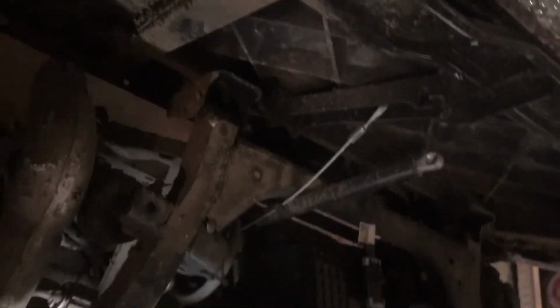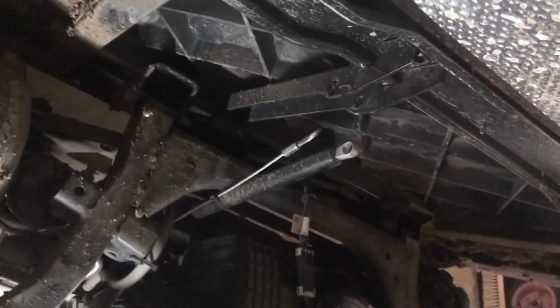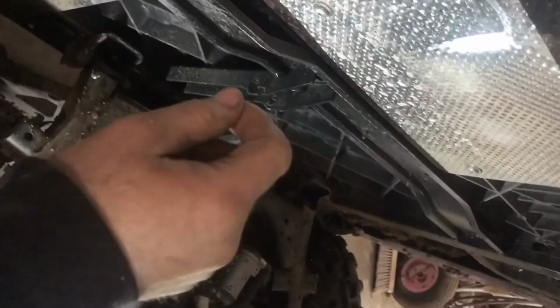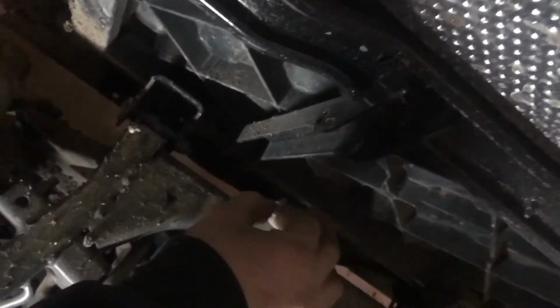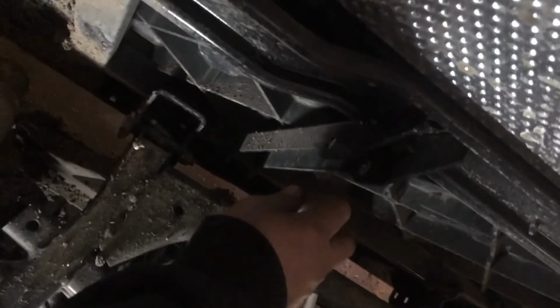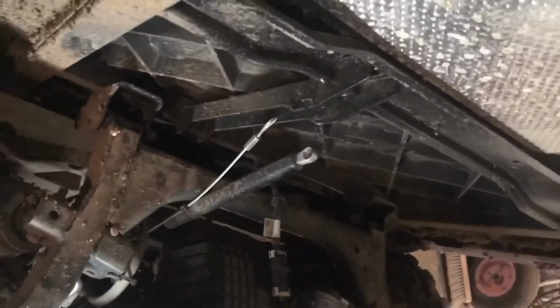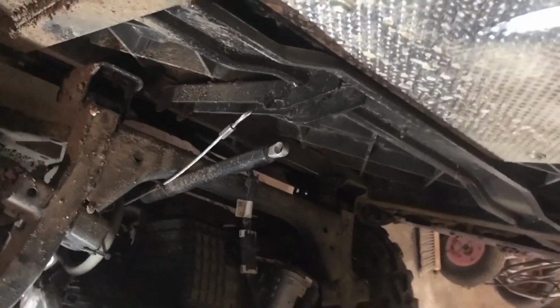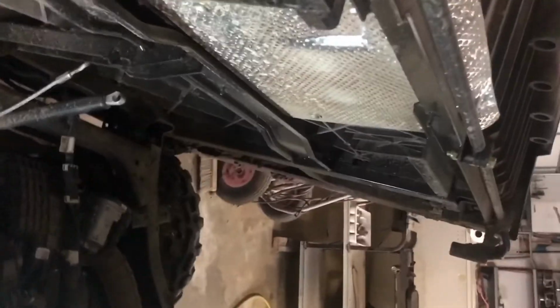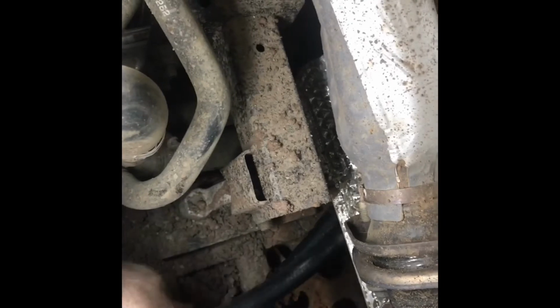And you're gonna want to disconnect this little bar and cable. It's a little tricky. It's easier with 2 people, because as you're sliding this pin out, you need to kind of keep moving this back and forth a little bit, and then that pin will come out, because there's tension on this all the time up until a certain spot, and then the cable holds it, so it leaves a little tension on that pin. It's hard to get out. You'll get it, but it's easier with two people. One person to work the pin, the other person to move the bed up and down, and don't whack each other in the head. Anyway, next time.